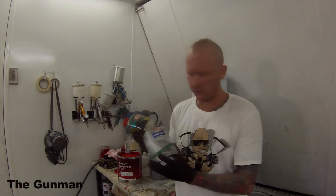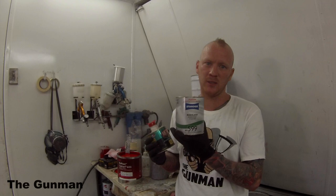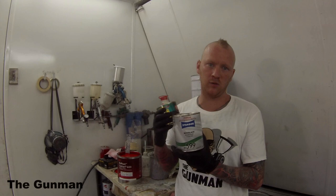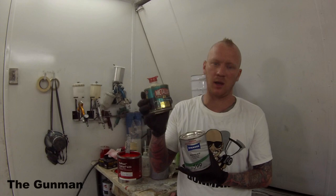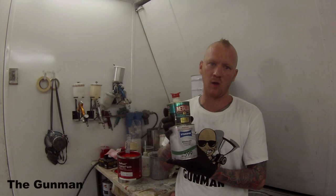We're going to put our own pearl coat over the top. So we put this base coat down first until we've got our coverage, then we're going to use this base coat stabilizer — basically a clear base coat. I sometimes call it blending clear. I can use it on metallics to help do blends, and I can also mix my pearl into it. We've got this Metalux Sunbeam Pearl, and we're going to be mixing that with the base coat stabilizer to go over the top of that Sting Red.